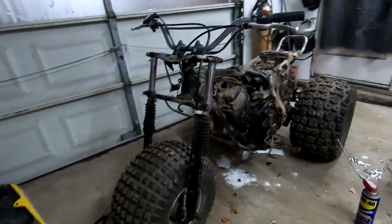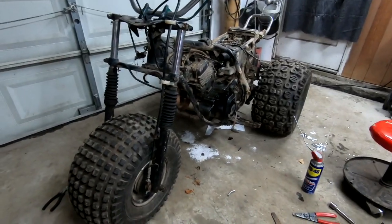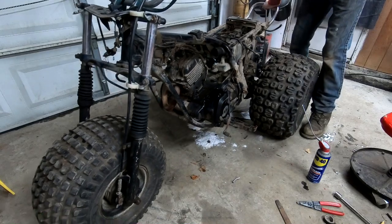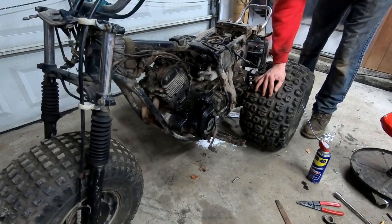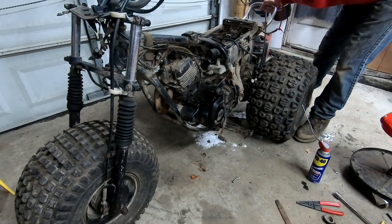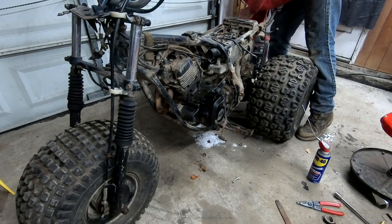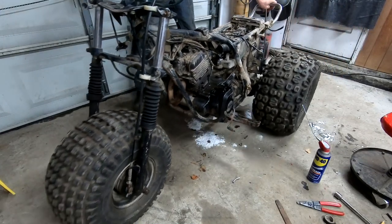While that's doing that, I'm going to go ahead and check the brakes on this thing. They get in the way of the tires, and there's not very much weight here — not the best, but they are doing something. Probably just need to knock some of the rust off. I think that's pretty good. I'll tighten that one up a few turns. Yeah, that's sweet — front brakes are good. That just needs a little adjustment.